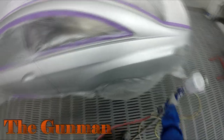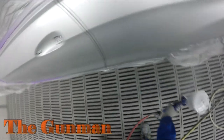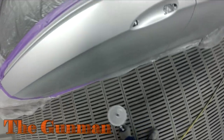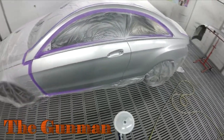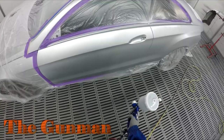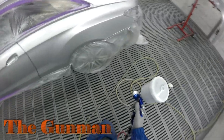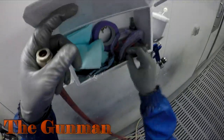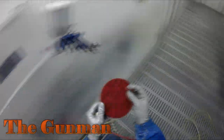This is actually a ground coat, not even the top coat color yet. When you're using solvent-based paints, we've got benches full of paint from previous jobs — I grabbed a silver, tipped them together, got something close to the car that you wouldn't even use as a top coat, and put a couple of coats of that down first. You get to about 50–70% coverage and then you're right to put the fresh mixed base coat over the top.